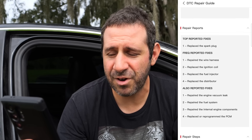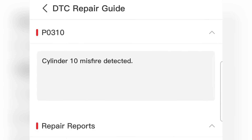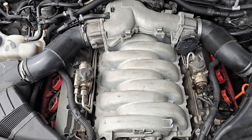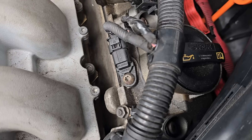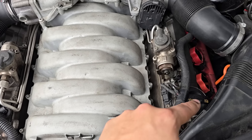We've got other codes to look into, especially P0300 multiple cylinder misfire, followed by P0305 — a misfire specifically on cylinder five — and P0310, a misfire on cylinder ten. Cylinders five and ten are the rearmost cylinders on this engine, which is a bit scary. To count cylinders, you always look at the one closest to the front of the engine. The rearmost cylinders in pretty much any engine bay get the hottest because it takes the longest for coolant to flow to them, so misfires on both rearmost cylinders tells me we might have something catastrophically wrong with this engine.